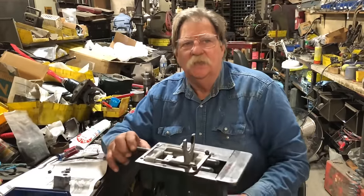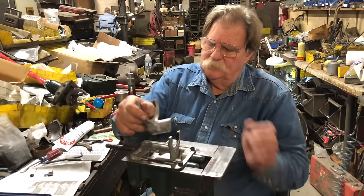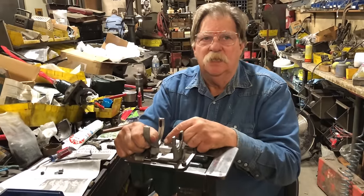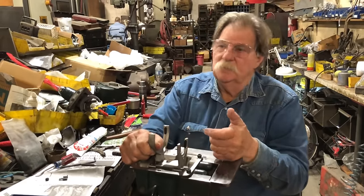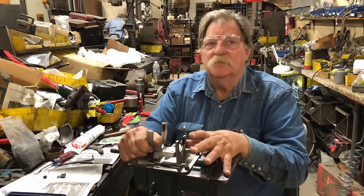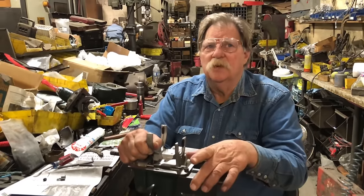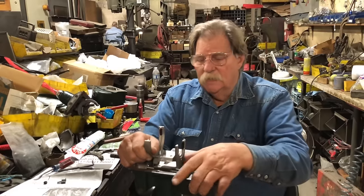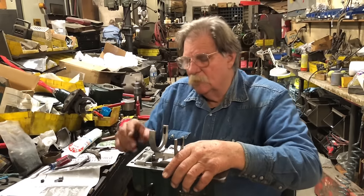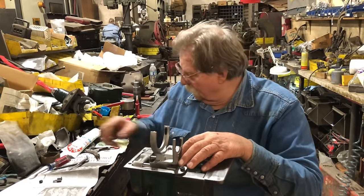These are my two spacers for the shift rail shim. Where you guys live it's not very hilly, so it's just a matter of adding shims to get to the mountain detent level. I add more shims in the detent itself. You could make it really tough and take some out later, or put more in. In hillier situations more pressure in first gear is better.